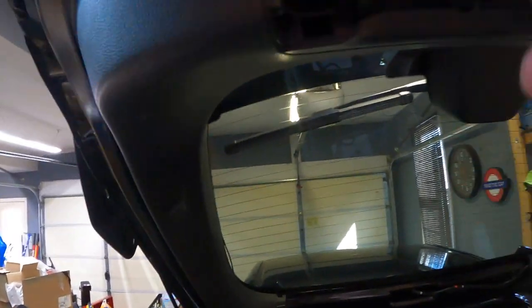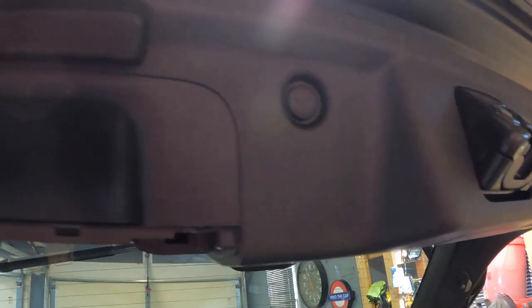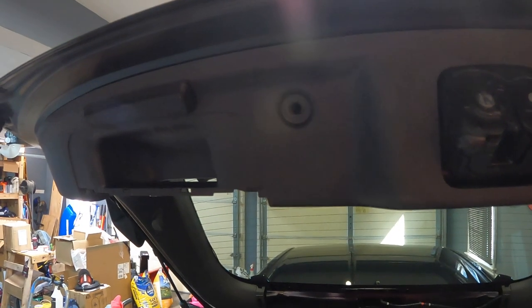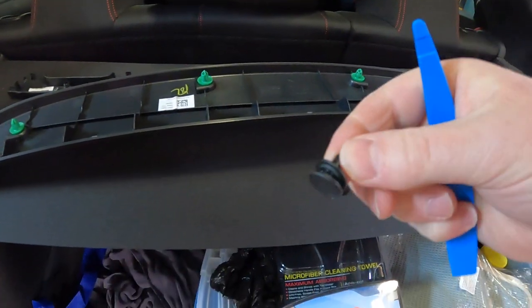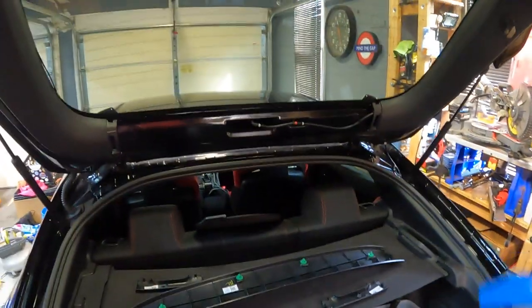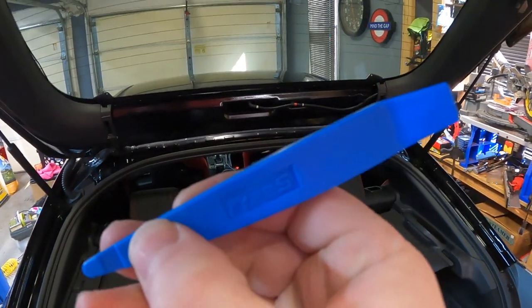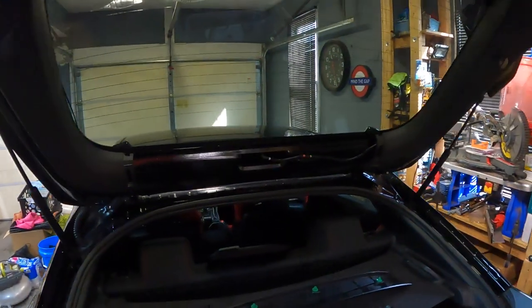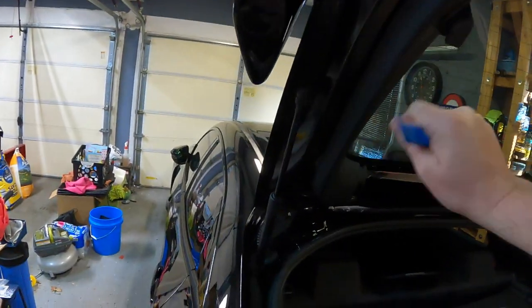All right, I got those off. Now the only thing holding this together — I can't remember if these clips have to come out, so I'm going to try to pop them off and see if there's something behind there. And indeed they needed to come out — they're just these little clips that you have to pry the top and then take the receiver out. I used a plastic trim tool; this one actually came from one of those cheap LED kits. So I took those two out — let's do another scan and see if there's anything else.